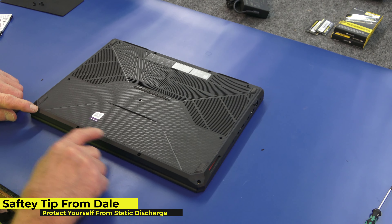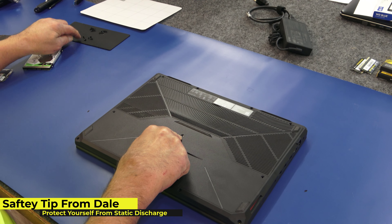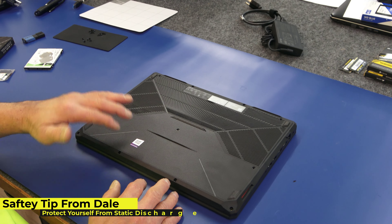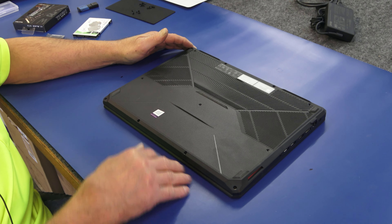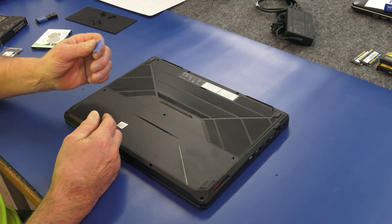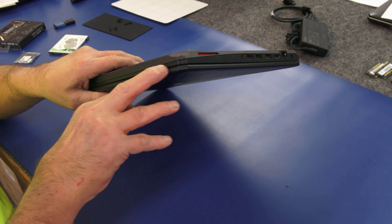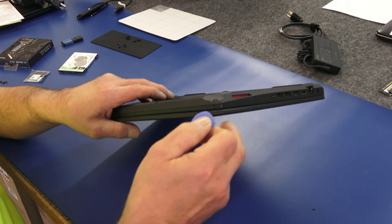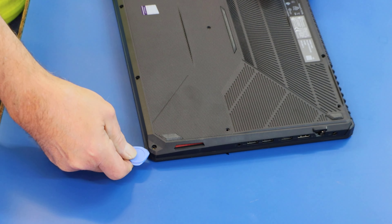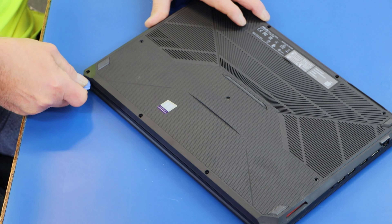There's only two length screws. The four along the front here are short screws, as well as this one in the middle. The rest of these screws are all a longer size. So just remember, you put the short screws in the short holes and same with the long ones. I'm going to use a plastic triangle spudger tool here to remove the bottom. Usually if you start in a corner, these ones lift up pretty easy, but right here in the seam I'm going to get my spudger in there and just start sliding along. You can hear it popping, which is good.